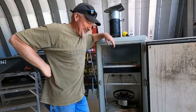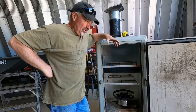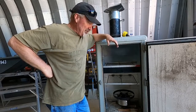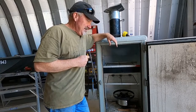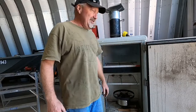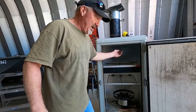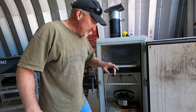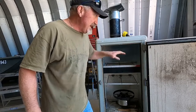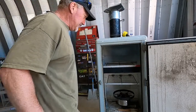I was just looking at that — I'm assuming it's straw or grass inside this icebox, whatever they used. I'm thinking I don't want to be smoking anything indoors like in the shop. Not that anything would burn easily, but if this thing ever caught fire and burned out the inside, it would be like a muskeg fire — burning inside the walls, and everything would be smoked and burnt to a crisp. So I've got to put a little silicone bead around there, and I'll end up siliconing around that air inlet hole too, now that I know it's dry grass for insulation. I guess they used whatever was available when they made iceboxes.